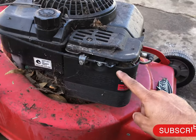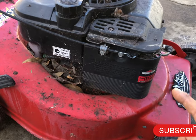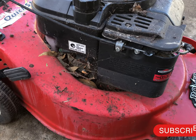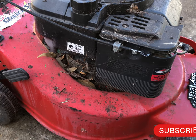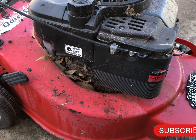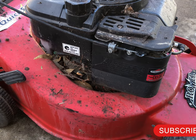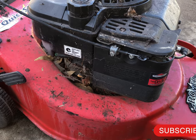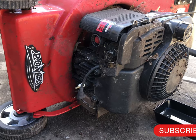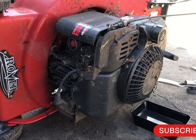I'll clean up, take off the filter cap and change the filter. We'll start the engine without the filter to see if it's gonna start. If it doesn't start, I'll get onto the carby. But first thing when you get a mower like this — as I checked in the beginning — you have to check compression first, otherwise we can't fix it. Let me start. While the oil is draining, let me do the spark plug quickly.